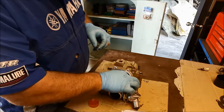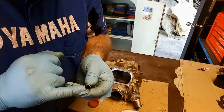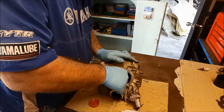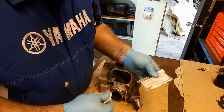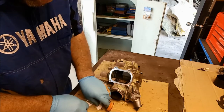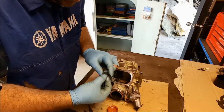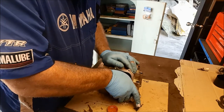These just fit over the valve guide. There's a little lip on there and a little lip inside. All we need to do is drop it in some oil, and then you should be able to push it over with your fingers. They're not a hammer-on thing — if you go anywhere near them with a hammer, you're going to distort the seal and damage it. It's a push-on thing normally, so don't abuse them. If you come to take them off for any reason, you'll have to replace them, because taking them off usually damages them anyway.